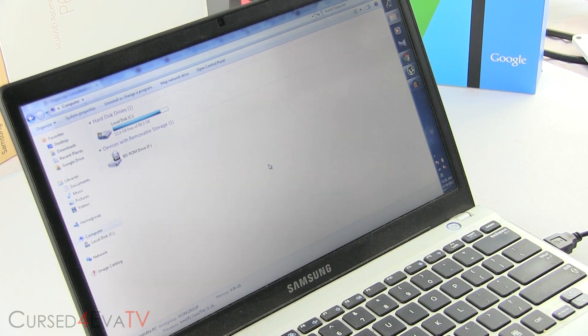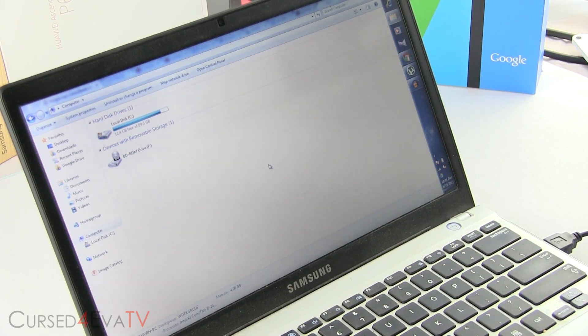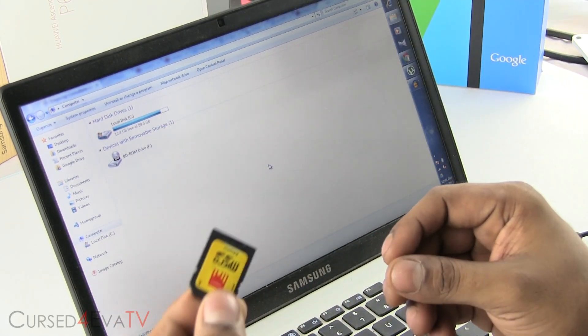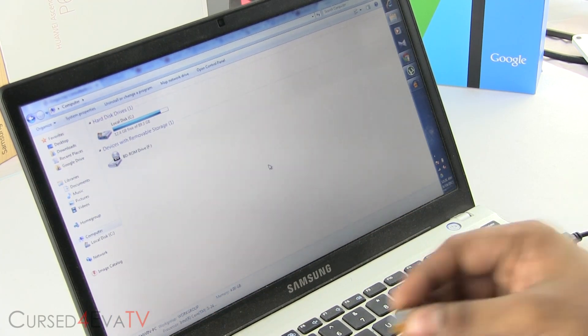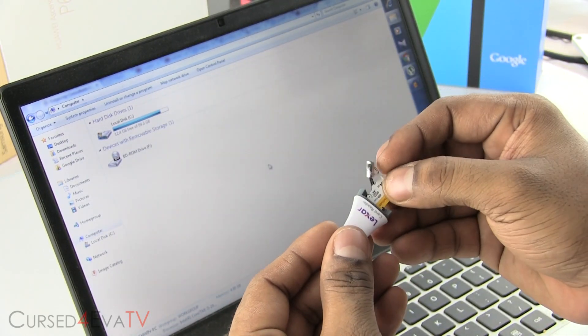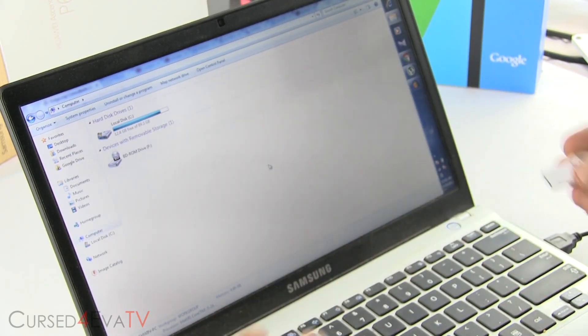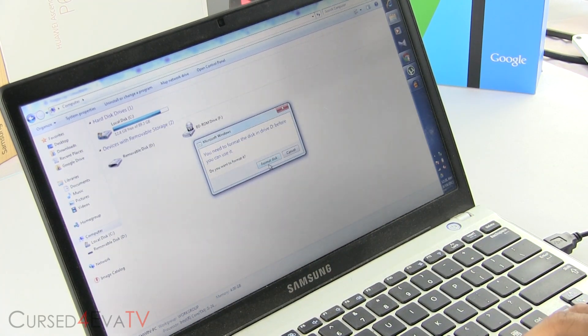The first thing you do is get your micro SD card out and find yourself a card reader. I've got the one that came with my micro SD card — a micro SD card adapter that goes into my laptop. Sometimes when you use a card reader, it might not be compatible with 64 GB cards. For example, I pop this in and it says format disk.